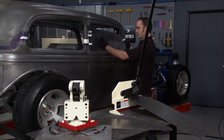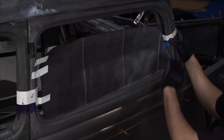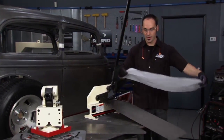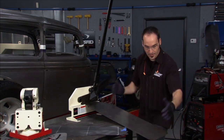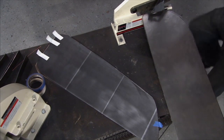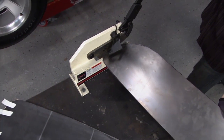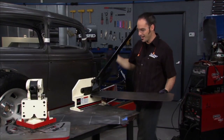I'm making my window templates — making them out of paper. You can see this is where the roof's going to come down, so it's going to chop and angle real nice. Take my paper, transfer that over to my metal, and now I've got a pattern. Once I've chopped off all the big bulky stuff on the kick shear, I can come over to the hand shear and make easy work of all the nice curves. So I'm making windows — but these are the kind you can't see out of.